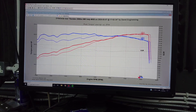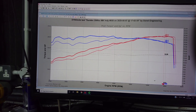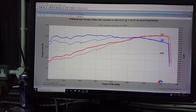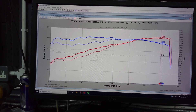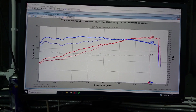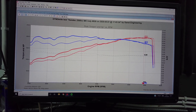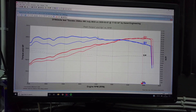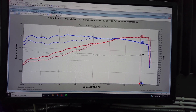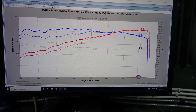I'll show you the VVT. We mapped it first without the VVT active — the blue line is torque, the red line is power, and the thin lines are without the VVT. As you can see, you lose a massive amount low down: we're talking 204 there dropping to 175. That's the case until about 4,000–4,500 rpm when it starts to pick up and doesn't really need the VVT as much. So it really is worth having it on even if it's only switched. On later runs I switched it out slightly later and that smoothed things out nicely — we've now got it switching out at 5,000. You can really hear that on the car as well; you can hear the note change at 5,000 revs.